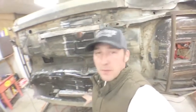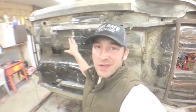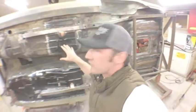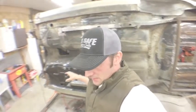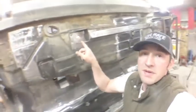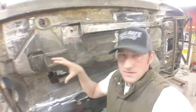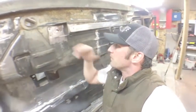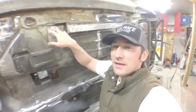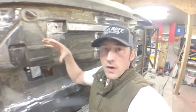I've finally got these subframe connectors pretty much in. I've got the bottom one tack welded. I'll finish welding that off camera. Really after that, it's just cleaning up the weld a little bit. There are a couple things that are really tricky when you're putting these in — you want to make sure that the distance from the pins back, you have enough distance there to actually get the subframe in and get it squared away. I'm probably about a quarter inch, maybe slightly less, where I know that the subframe will end. That gives me a little bit of room to make sure that it gets square when I'm done.